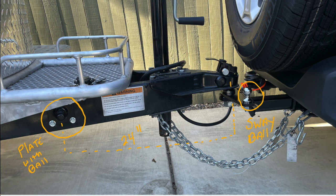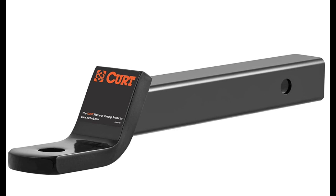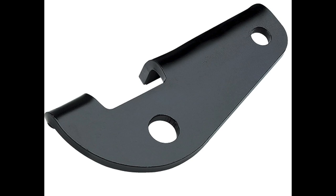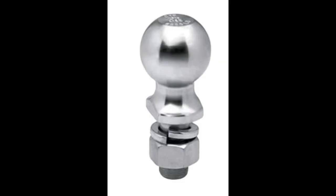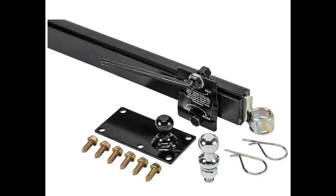Here's an overview again: the plate with the ball, 24 inches to the center of your hitch ball, and the separate sway ball on the side bracket. That's our hitch, but you probably already have one. The bar itself is not super cheap but definitely worth it and very secure. This is the separate bracket and small ball hitch we had to buy separately. Here's the full kit — it's by Reese, which is a really well-known hitch brand, and it's very reasonably priced. There's a link below.